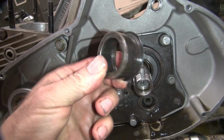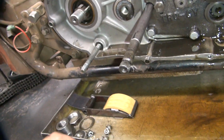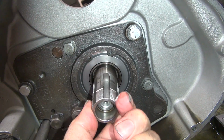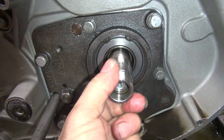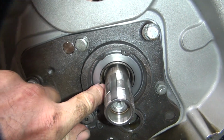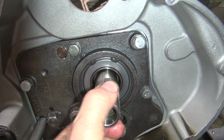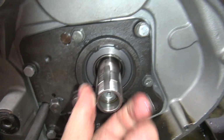And this has been modified here because there's other modifications on the inside. So, if you notice, the bearing doesn't really engage very much in high gear. There's been some changes going on in here. I don't recall it being that deep into the bearing though. That's just about completely off the bearing. And that's kind of binding. So that's not supposed to be that hard to turn. Something's not right in there.